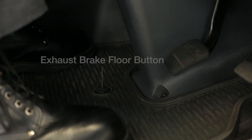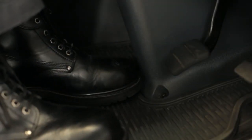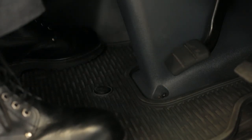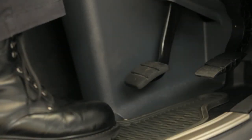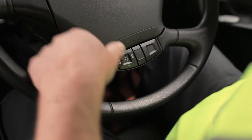Alternatively, use your left foot to press this button on the floor in front of the steering column. This button works all the time, even if the dashboard switches off, and it does two things. If the gearbox is in automatic, it will change down to the gear which gives the most effective engine braking, and all the time you're pressing the button, the exhaust brake operates. When you release the button, you release the exhaust brake, but the truck will stay at high revs so you'll still have engine braking. It changes back to the best gear for driving when you press the accelerator pedal, or press resume for cruise control.